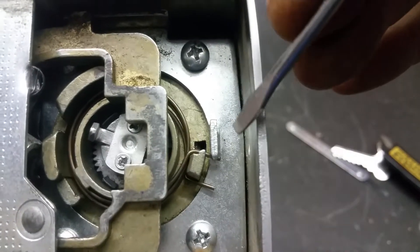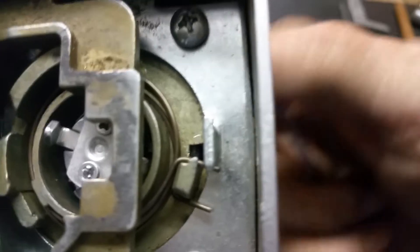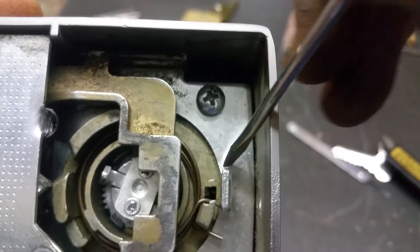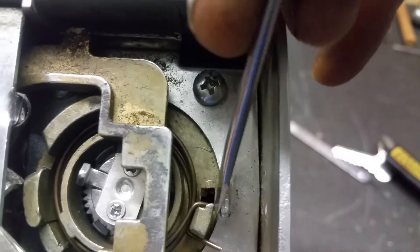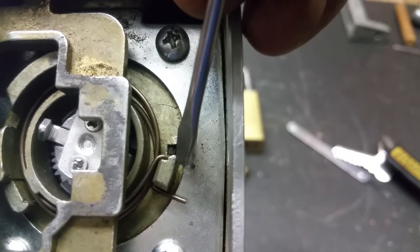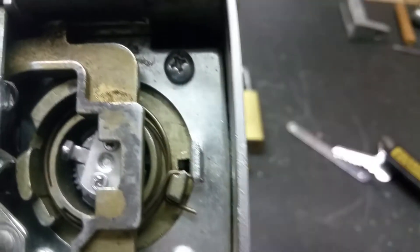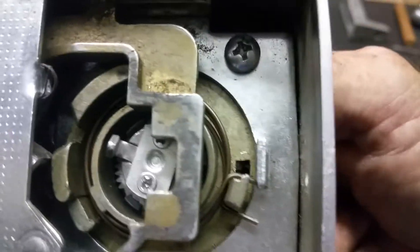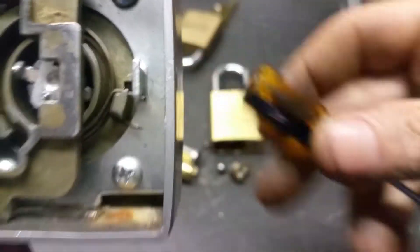This is how your setup is now, which is obviously incorrect, because the top part of the return spring should be over the actual post. What's happened with yours is the spring is actually broken here, and what's left over is actually just bent over in this direction. So it's overriding that main post on the backing plate every time, and when you turn it, it's overriding and staying in that position.